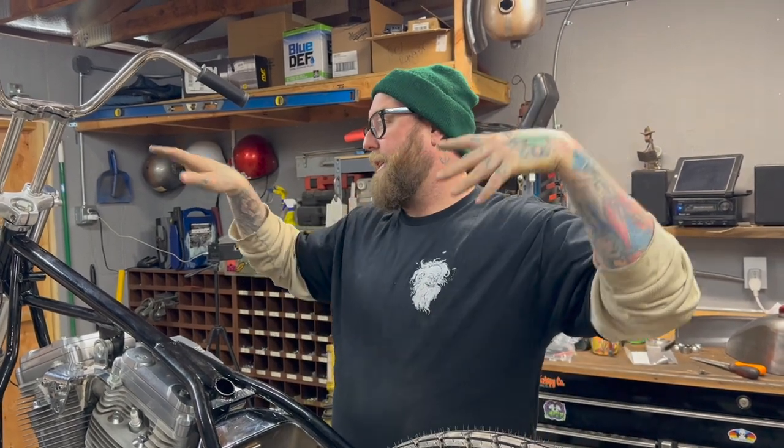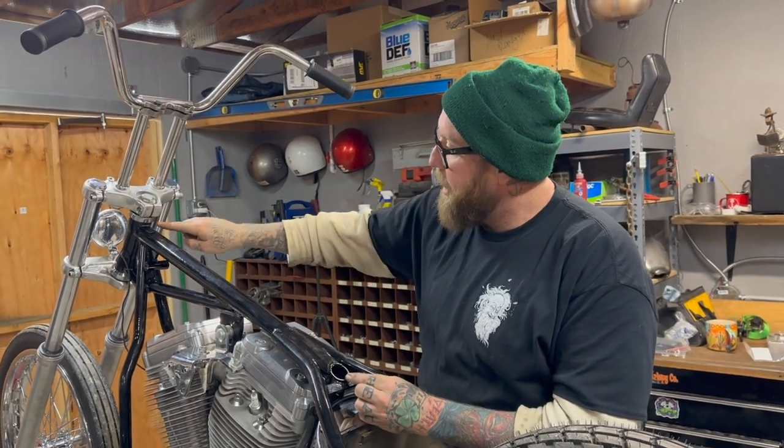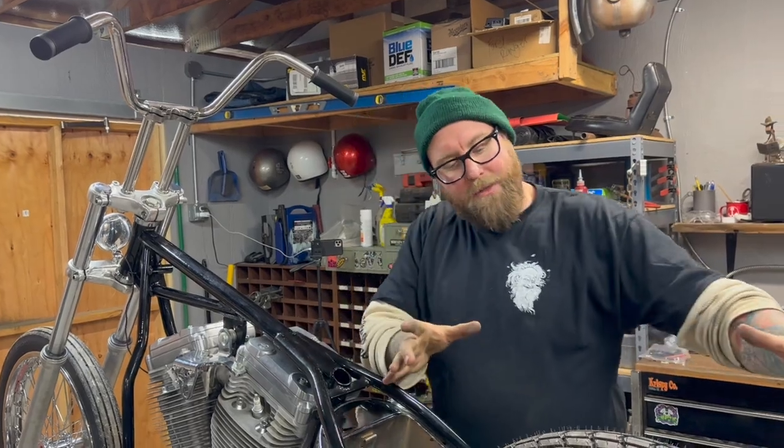There's all other kinds of weird stuff that could throw a bike off. But the better we get this now, you can ride with no hands and maybe stand on the seat and be that kind of cool person. But anyway, I'm gonna start here and here, and that's all I care about. Because if I know I'm straight here, then I'm straight going back, and then I'm gonna move the wheel to where it needs to be.